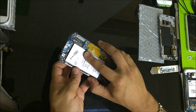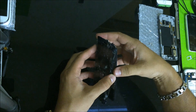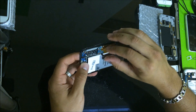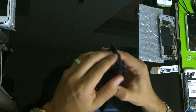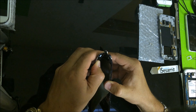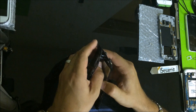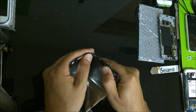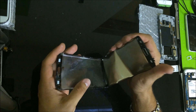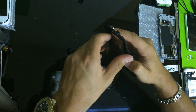You're going to want to disconnect the home button before removing everything off from the bottom, because if you don't remove the home button, it could get stuck and break. Let's remove the bottom piece carefully. It looks like the menu button and the back button are already glued on there, unlike the S5. That came off pretty easy and now we're just going to finish removing this.